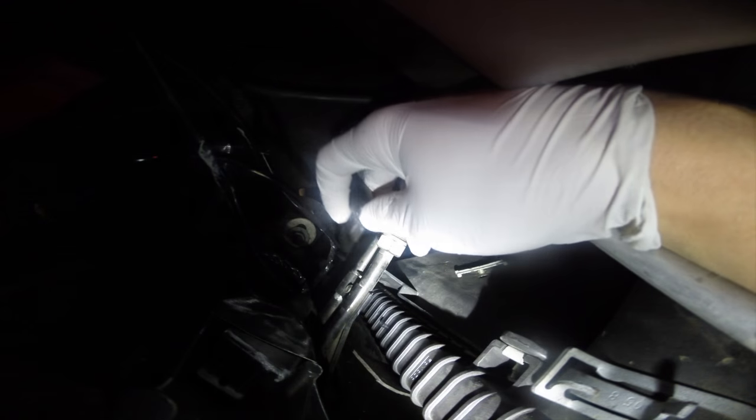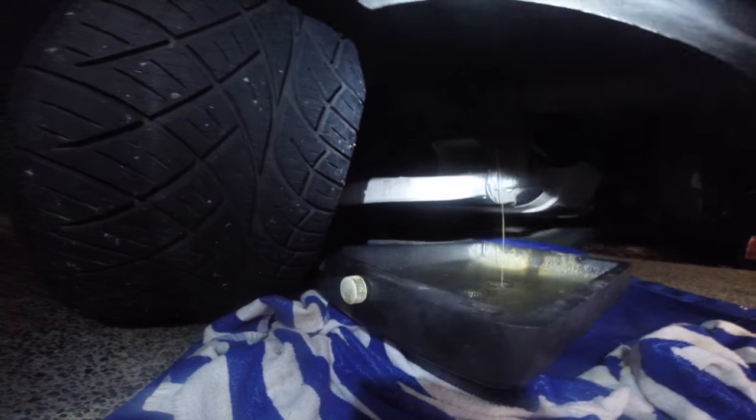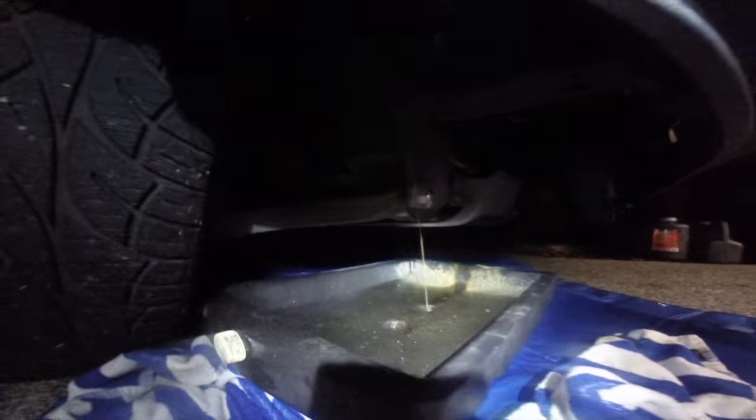Right here I'm going to point again to where the rubber tubing needs to go — right there. Once you look under your radiator you'll see it's either on the passenger side or on the driver side, usually on the corner of the radiator. Here it's draining — you can see it's pretty nasty brown gunky stuff.